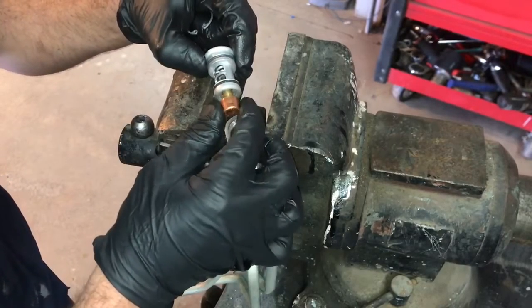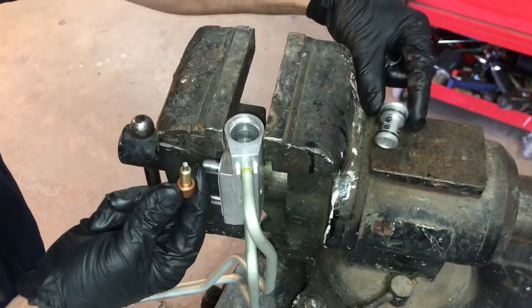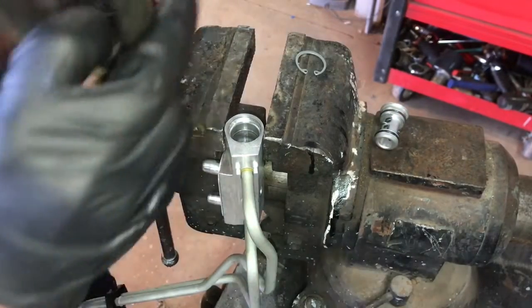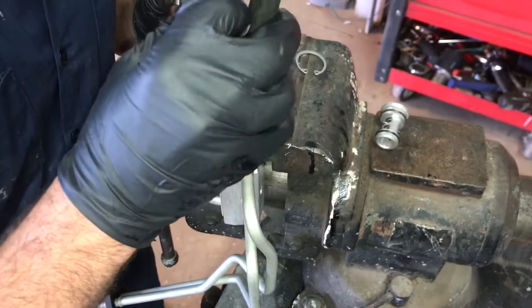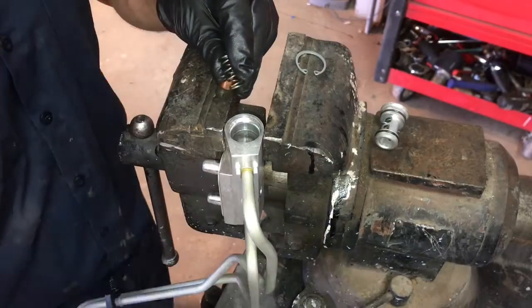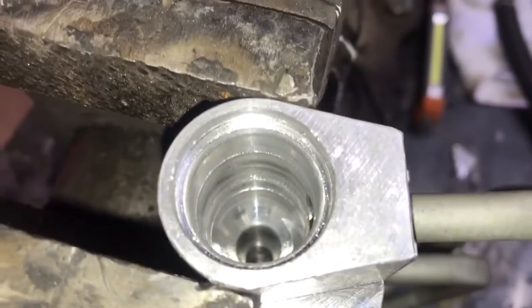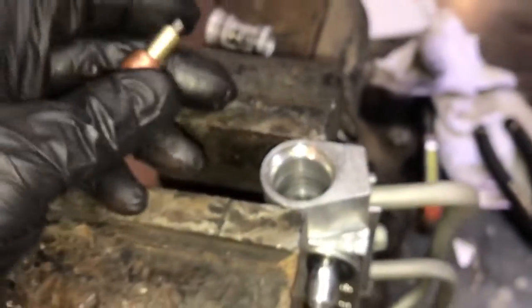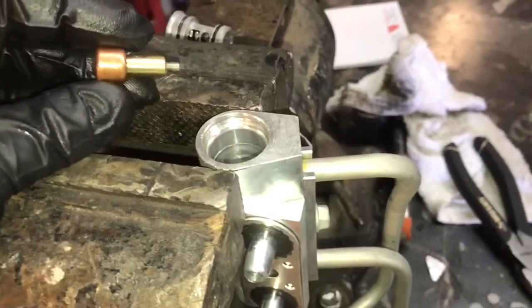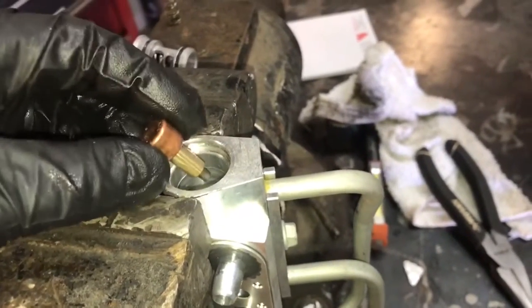As you can see, the heavy side of the thermostat is facing down. Here's the cap right here — we're going to set that aside and then use some needle nose pliers to remove the spring that's inside of there. To give you a better idea, the spring sits inside of that small hole down there, and what we're going to do to make sure that fluid is always flowing to our cooler and is not in bypass mode is flip the thermostat upside down.